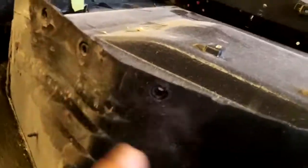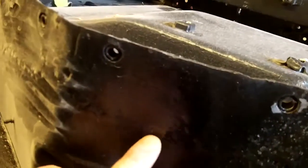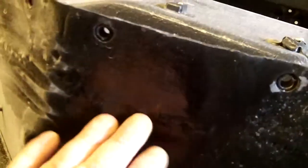While I'm here, I'm probably going to do a few other things. I'm not happy with this. This was done quite a while ago, probably almost a year ago, but this was a previous repair that was done by the previous owner, and it's kind of a sloppy repair. At one point I thought I was just going to cover this and just be a bit of a driver and not worry about it too much. But if you're looking inside the wheel well from the front of the car, you can actually see this panel. So I think I'm going to strip this back down, and throw a bit of short strand fiberglass filler over here just to clean this up, and then we'll recoat it again. So I'm going to end up redoing a bit of the work that I've done, but that's okay. A few other sloppy little parts. This is extra leftover filler from when this was done on the other side, so that'll have to be ground down. So yeah, some work to be done on the tub for sure.